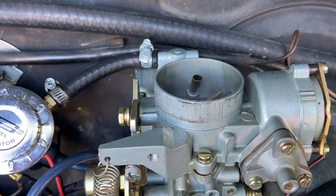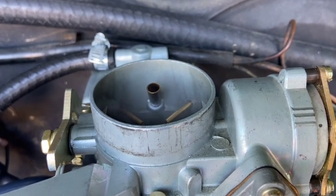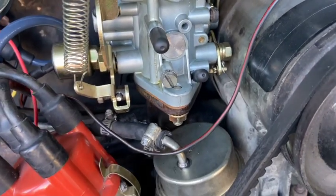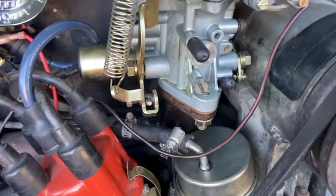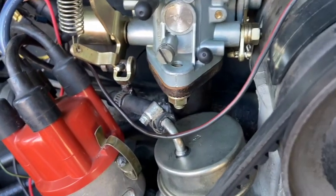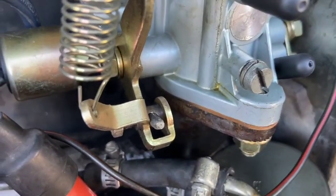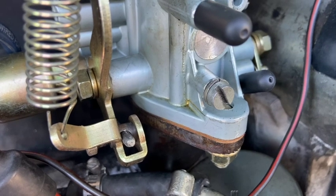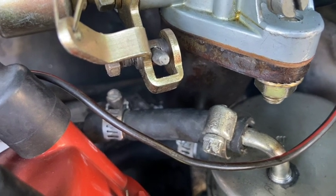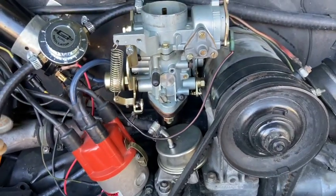So I don't know if that's a good sign or a bad sign. It's been about 5 minutes, maybe a skosh more, but still dry around the manifold. I don't remember when it first started to sweat, but so far, so good. My prediction is the fuel regulator is working, because I don't see any fuel pushing through that gasket there or any sweat. You probably can't see it going down the throat of the manifold. We'll give it a few more minutes and then I'm going to try to start her again.